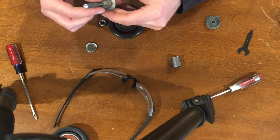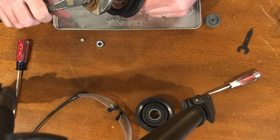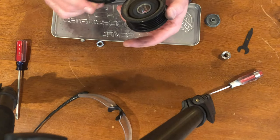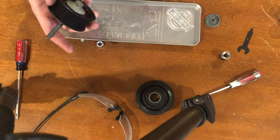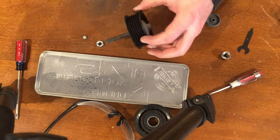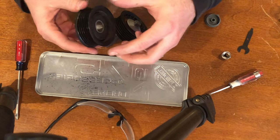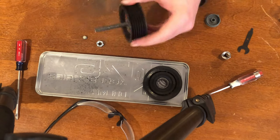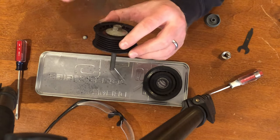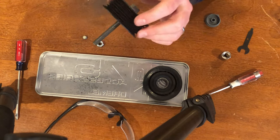We'll thread the nut on all the way down to the bearing. We've got the bearing put back together with the replacement bearing — this is the old one. The idler pulley is essentially what it is, and that's why we're replacing it. We're replacing it because it has a squeak in cold weather per the technical service bulletin. Here's the new one — the bolt's in, 13 millimeter. Now that we've shortened the bolt it should be easy.